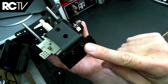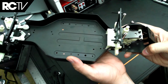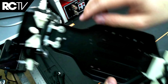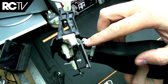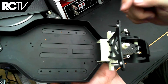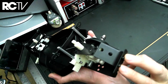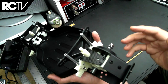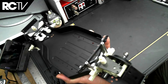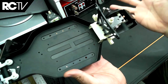The last step is to screw in these two screws. Use some thread lock — the kit doesn't include it, but in most metal-on-metal places, like the camber link mounts, the screws holding the shocks, and these four screws holding the motor plate, they tell you to use thread lock. Blue is what you want; you don't want the red stuff, which is very high strength.